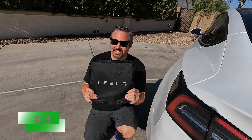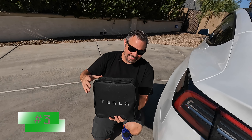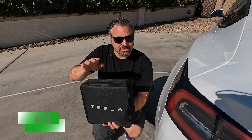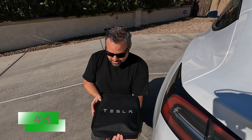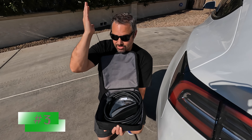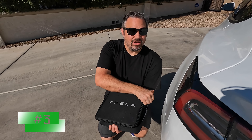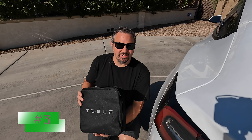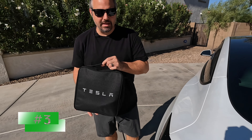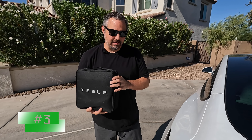Don't forget the mobile connector or any type of charging cable — it could be third party, but we recommend just getting the Tesla one. Order it when you order the car because the base Model 3 did not come with one. Be sure to pick up the mobile connector or a wall charger if you already have 240 volt in your garage. You're not charging at home without one of these unless you go to a Supercharger. We're getting about three miles of range added per hour on the standard 110 volt outlet.